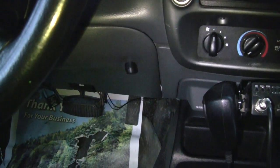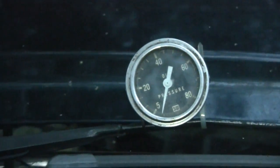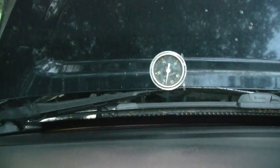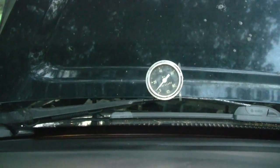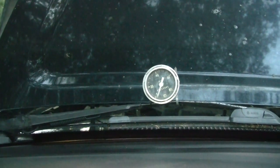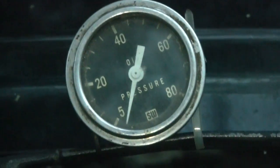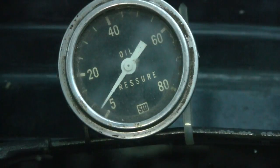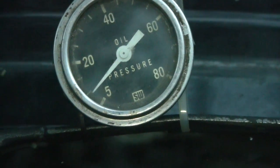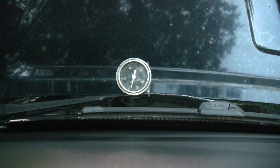Let's give this thing a real quick test. That's our switch down there, and we've got our oil pressure gauge temporarily rigged up there. It certainly doesn't build as much pressure as my pre-oiler in my other truck — that's no question. It's making about 10 to 15 pounds, more like 10. But that might be enough — this truck isn't nearly as worn as the other one, so that might get the job done.